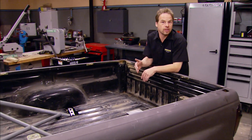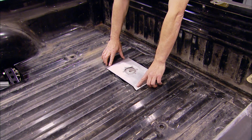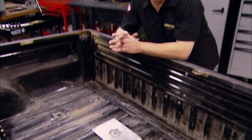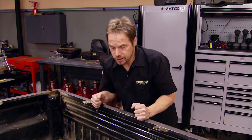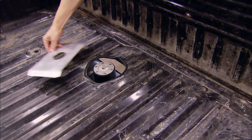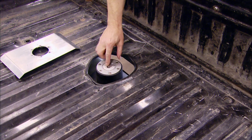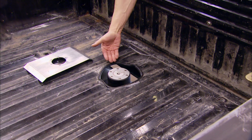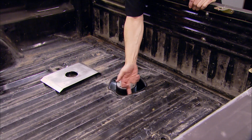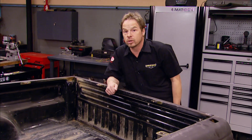Speaking of fuel, we've revised the fuel cap setup since the last time you saw it. We used to have the fuel cap mounted in an aluminum plate hard-mounted to the bed floor, but we got to thinking — this is going to see some pretty aggressive driving and possibly some track time. If we got into a collision, we didn't want a problem. So we cut a larger hole in the floor, made a little neck on the fuel tank, and isolated the fuel cap right there. We've got plenty of clearance around the bed floor and ensured there's no spark risk at the fuel vapor contact point by using vacuum line and weather stripping adhesive to seal it up.